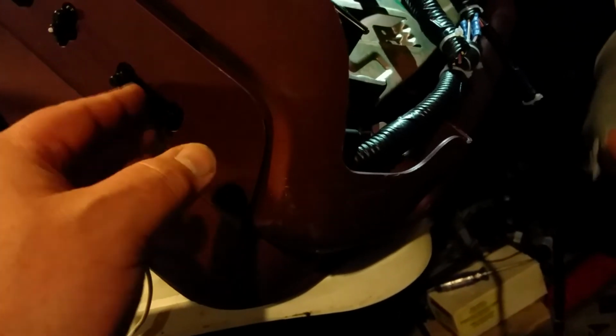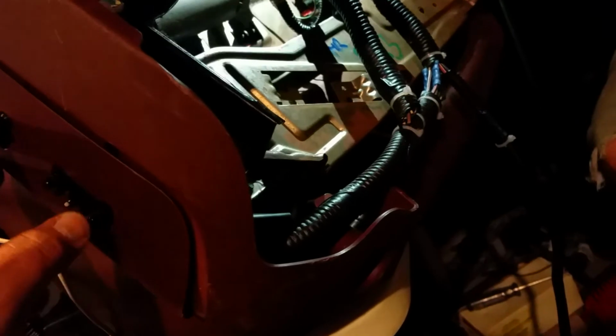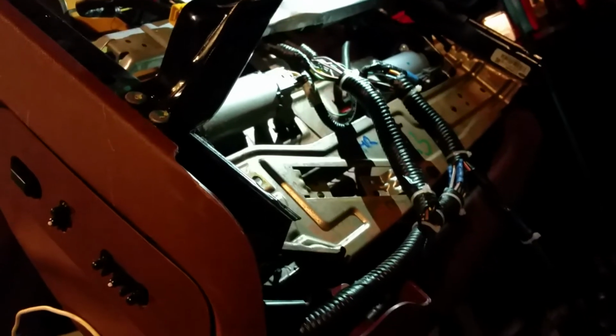So we figured out what was putting out hot for forward, what was putting out hot for back, and what a switch does is reverse the polarity on the wires, for those that don't know. So you find your front and your back wires, and then you hook them up to your front and back over there on the motor, and it's switching the polarity and makes the motor go different directions. And so we found all those off the switches, and then we found the bigger wires, and we just played a guessing game and tried to make as educated a guess as we could. We took the hot and hooked it to one wire on the motor and then the negative to the other one, and it would move the track one direction. Whichever one the hot was on was the hot for that direction. You switch them over, and then the motor goes the other direction.